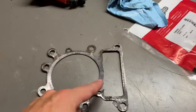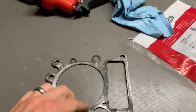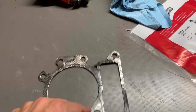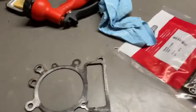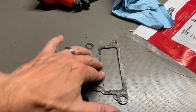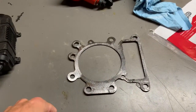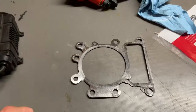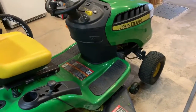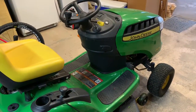Looking at the gasket, the oil was coming from the pushrod galley and seeping into the combustion chambers - combustion gases were drawing in and sucking oil through. You can see that's exactly where the failure point was. Why does that happen? All these bolt holes hold the gasket tight, but look at the spacing between bolts over here - there's nothing really putting pressure in that area. So it's always going to be a possible failure point. In my case it was after five years, but only 80 hours - for some of you, that's just one season. Thanks for watching, please leave questions below.